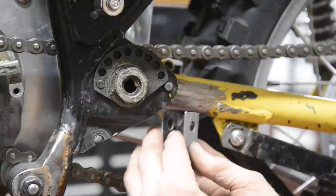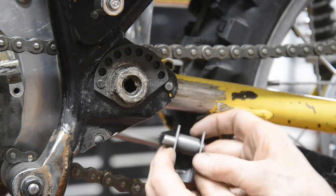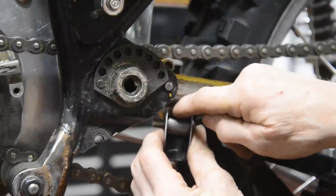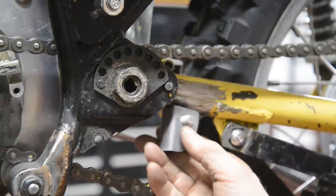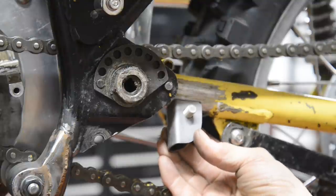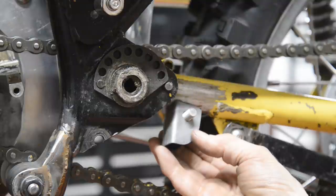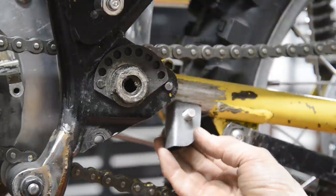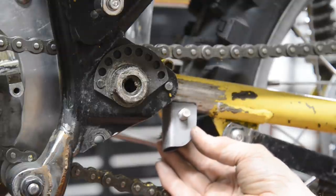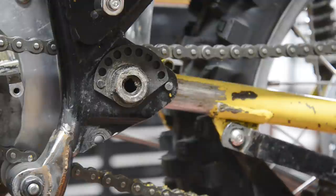Now our piece goes in there. Now, when it has a bolt in, see, even when that's tightened up, this piece that the leg is going to be on can still turn. So that's going to go on there like thus. I might just take a little bit more out of there to slightly angle it that way, because if it goes down straight like that, there'll be too much of a tendency for it to flip back up with the spring. We want it to go back like that. So let me just go and file a bit more out of there, and then I'll bring it back.